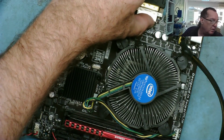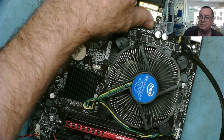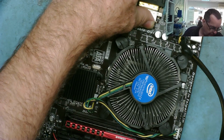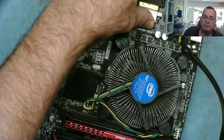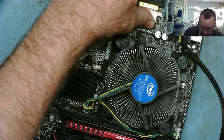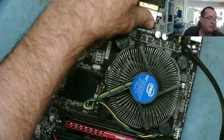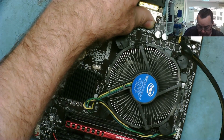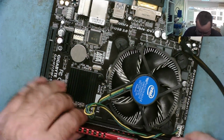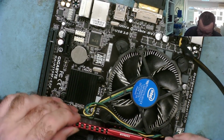Well, actually now I don't get a blue light on the monitor. Oh, I do get a blue light on the monitor, but I don't get a picture. I'll just restart a couple of times. Yeah, blue light's coming on but no picture, and it's stopping and starting again. Okay, the fourth time it's still not actually booting up. Okay, so I think I've just switched off the power supply. Let's go again. I have some more DDR4 here, which I'm also just going to try in a minute.